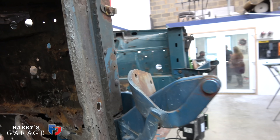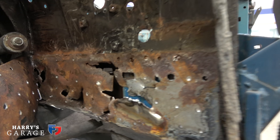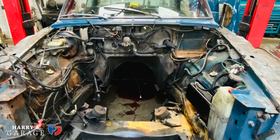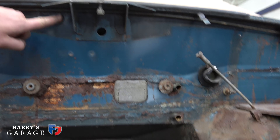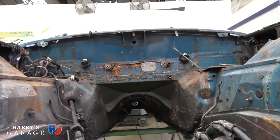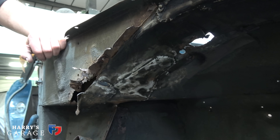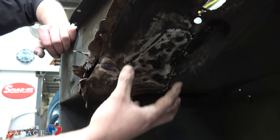On this side, the repaired chassis leg looked nice, shiny and strong — but take it away and the horror behind it is revealed. On the passenger side, still untouched, it all looks very strong with a previous repair section done to a nice standard. But once the engine is removed, you can see all this corrosion on the inner joint — the reverse side of that plate. Pull the plate away and what looked like a good section turns out to be rusting away behind. Also up front, this area is swollen and corroded, generally from debris going down the air intake.